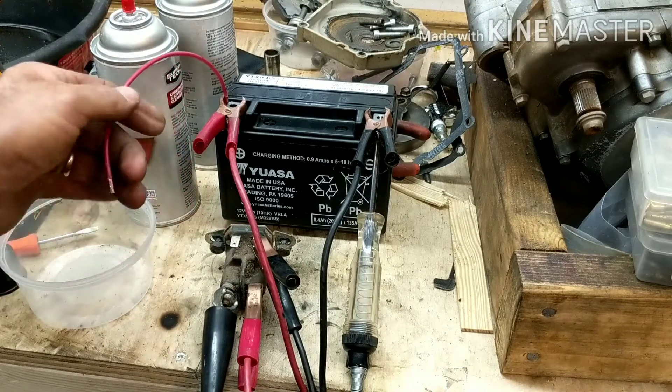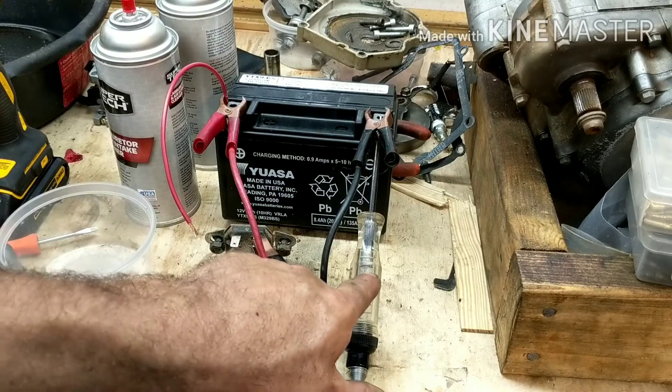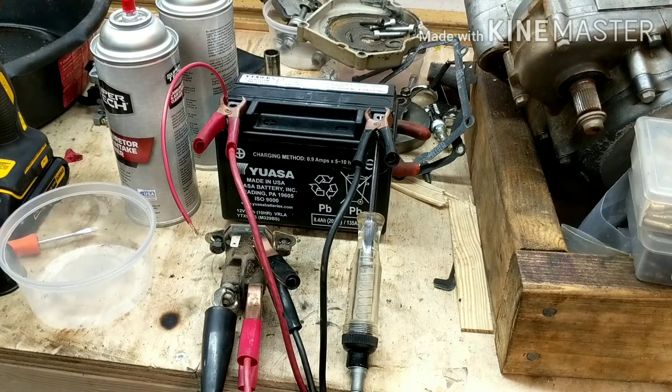You can hear it clicking because it's trying to. So it's clicking, but it's not connecting to power — it's not turning my light on, which would tell me that it's sending power here. This is a bad solenoid. This is what it looks like.